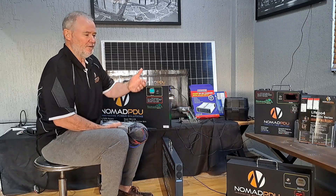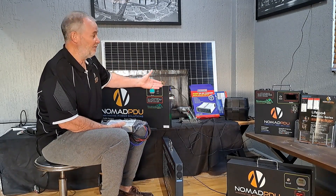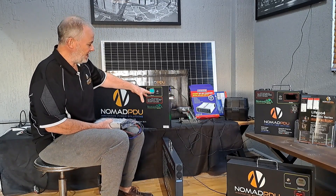At 50 amp you don't need to go any higher — say 100 amp charge. At 50 amp, if you're running two or three fridges you're still going to be charging around 40 amp an hour. Drive for an hour and you pretty much cover yourself for the whole day or 24 hours.